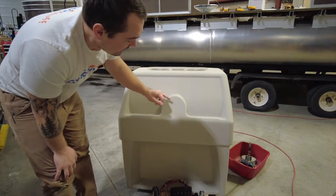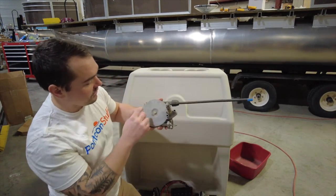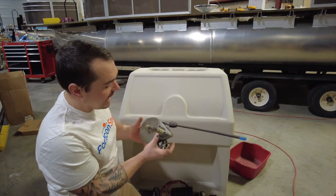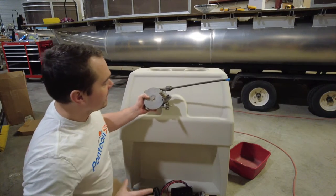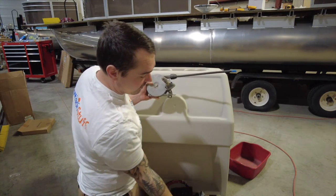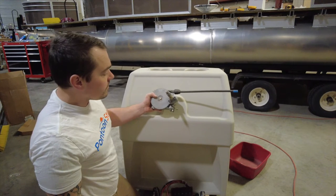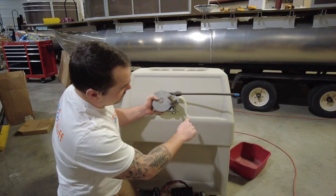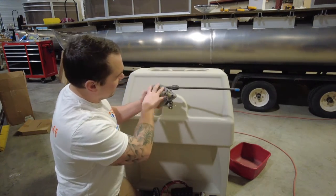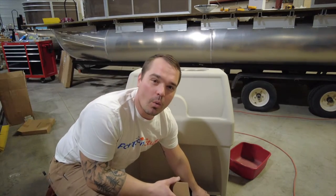You could design this however you want in terms of where everything goes. One thing to keep in mind: your steering helm is behind the plastic behind your console, and you have to fit the rotary housing in there — it's going to insert out through. So if you put your switch panel right next to where the steering is going, that can lead to some problems. What I tend to do is put the switch panel on the opposite side of where the rotary housing is actually going to be. My steering cable is going to come up from under the pontoon, bend right into this hole here, so I orient things to leave plenty of room for the cable to come up and get in underneath the switch panel — mid-way up or even toward the top — so I don't have any interference with my steering cable, the housing, or any of my other electronics.